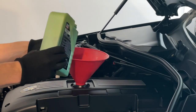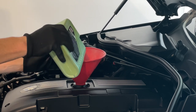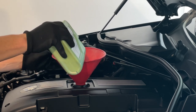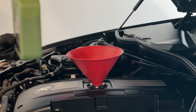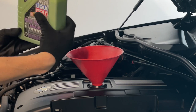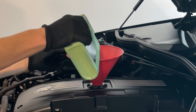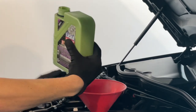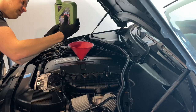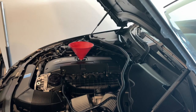I'm going to take our next quart of oil here — gets us to 6. It takes 6.8 quarts, so we're on our 7th quart. We'll pour a little bit and check — it's right on 6.8.